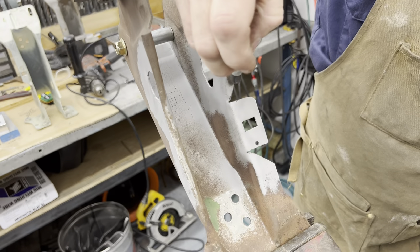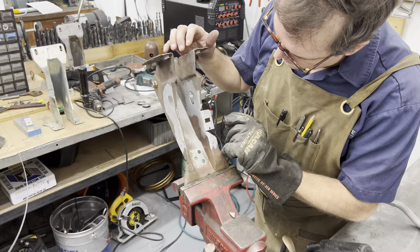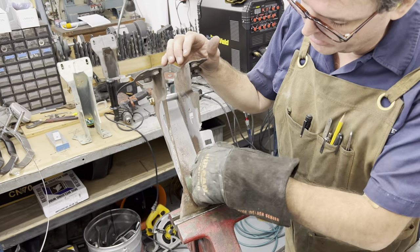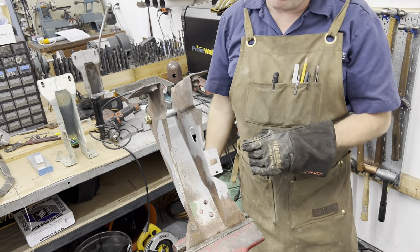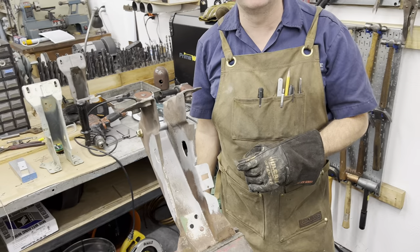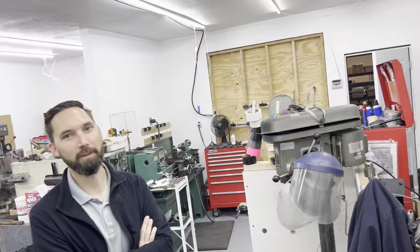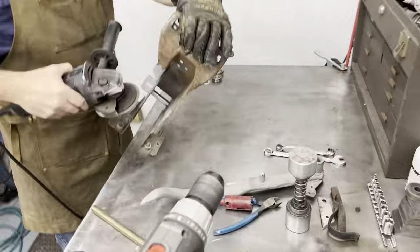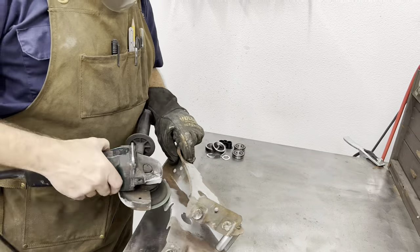What I did here is come in at an angle, and over here it's for clearance — but it's mostly aesthetics so you don't have any sharp edges. I'm going to take the angle grinder and smooth this up, because otherwise it'd be a sharp edge you'd snag on when doing wiring underneath the dash, which is already painful enough.